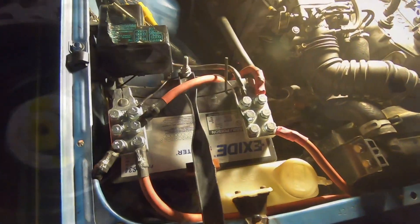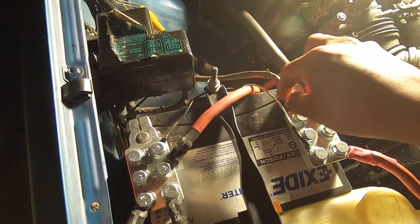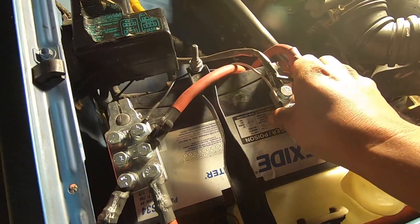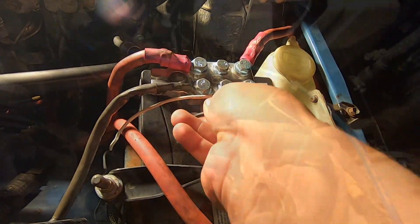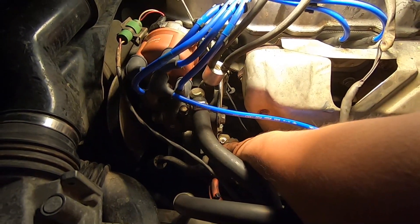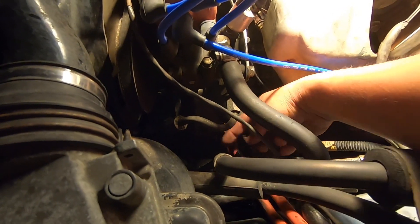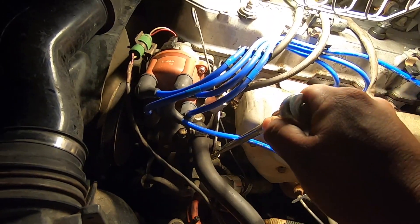Let's go to the truck and start taking it apart. We'll start by removing the battery post and putting the battery on the charger — we have to use an Allen wrench for these. We used these same posts for the big four upgrades, that's why we have them. Nothing here should have power anymore. We're going to get to this 10-millimeter nut, and then undo this 8-millimeter nut for the ground that we ran to the alternator — if you haven't watched that big four upgrade video, go check it out.